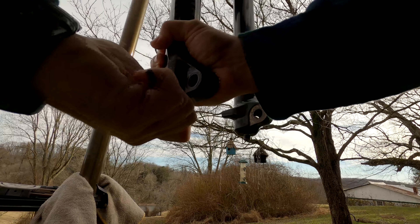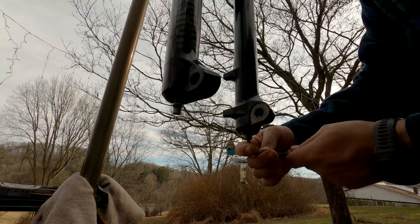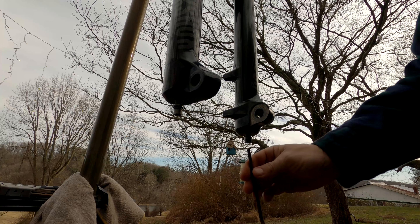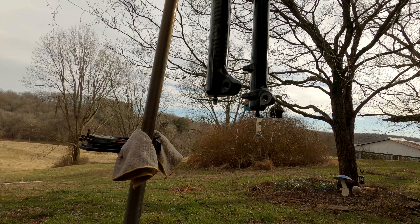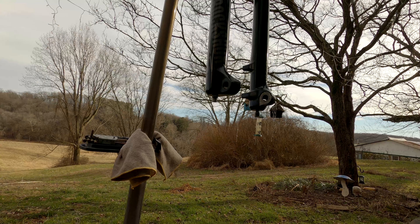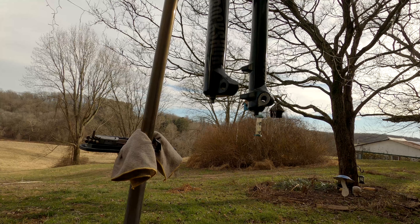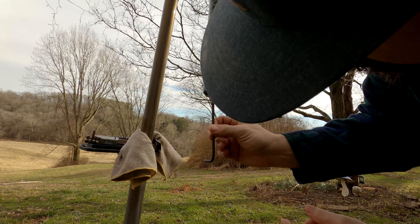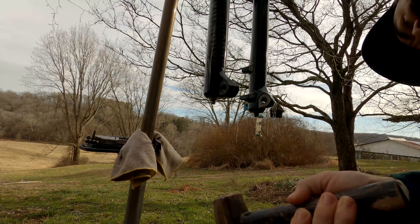Now we're going to loosen our two bottom bolts. We want to take these out just a little bit, leaving some threads in there, and loosen the other side — this is our air damper side. You want to just leave it with a couple threads showing, because we're going to whack it with a hammer and that's going to break loose the rods connecting the internals. I find it helpful to put one hand up by the dust wiper while you're whacking the bottom. You start seeing oil come down — now you've got it. The other side may need a hit again. There we go, she's loosened out.